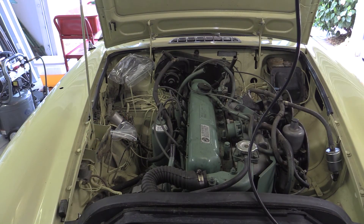Yesterday we took the two brake boosters off and sent them up to White Post in Virginia to be rebuilt. We had to cut the vacuum hoses off to be able to remove the vacuum booster, and now we're trying to get the clip off that holds the hose in place so we can replace the hoses, which should be arriving sometime tomorrow.